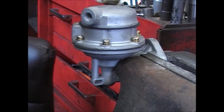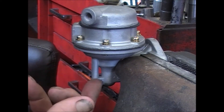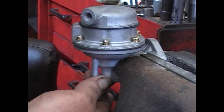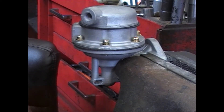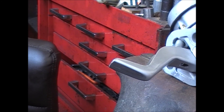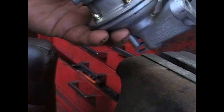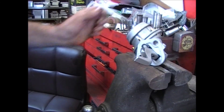Another small test to make sure that the oil seal is sealing: this tube right here has a vent — there's a hole up inside of here; some of them have them in different places. Block it off and try pulling the arm up. If you feel resistance and it tries to suck your fingers in, that tells you there's a good seal. Don't forget to put the plug in. That's it — any questions, give me a call.